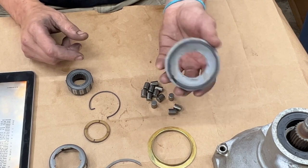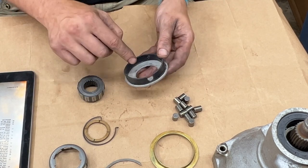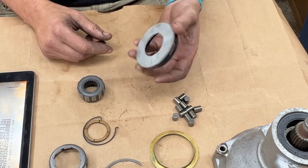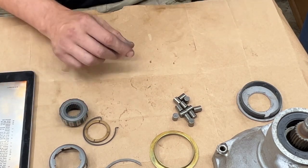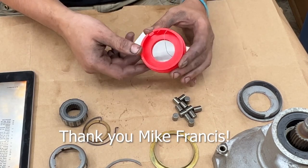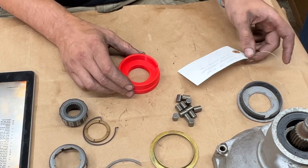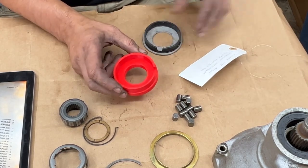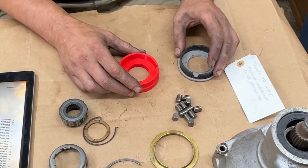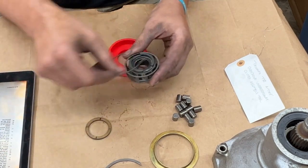For assembling the unidirectional clutch, I made a tool myself for my A-type overdrive. Jed Mattley sent me a picture with measurements and I made my own. But about a year ago, someone from YouTube 3D-printed one based on my video and sent it to me — so thank you so much! We're going to use that one. It says it's for A-type overdrive but I believe the size is the same for J-type.